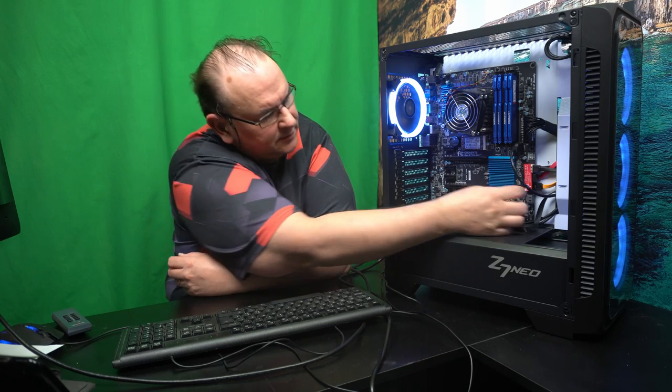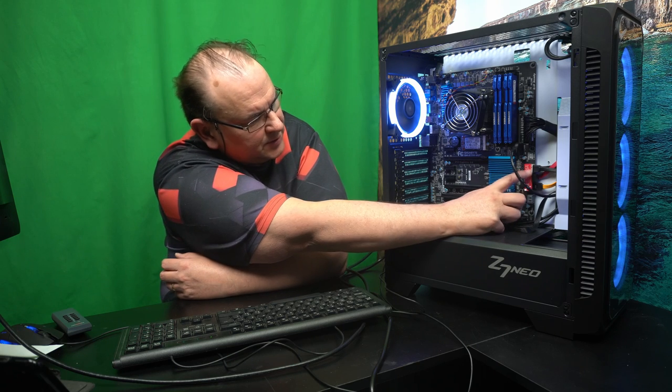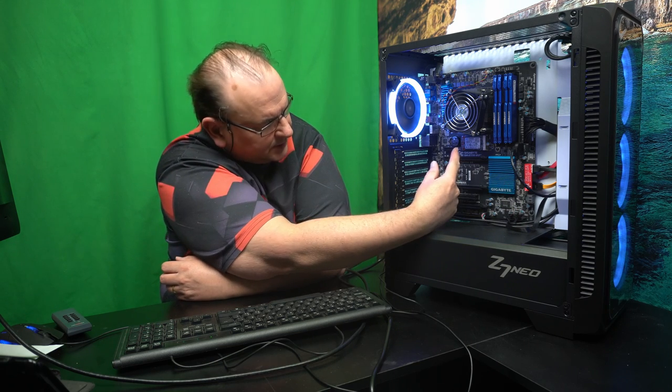So now we have it all working. It turns out that monitor is actually dead. I was hoping to be able to use it for a little bit longer, but it's going back to its dead state. But anyway, basically there were two problems. This SATA connector seems to be dependent on software, so you have to install drivers in the operating system to access this. There's no direct BIOS support. So these ports are supported in the BIOS, and one of them gets eaten up by the onboard SSD. And then we had to sadly swap out those half terabyte 5,400 RPM drives for the 250s.